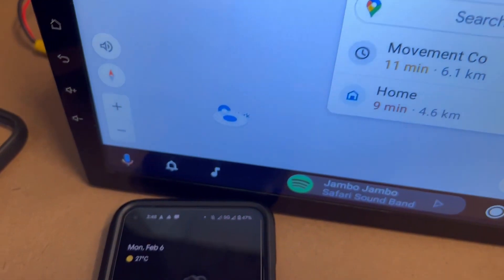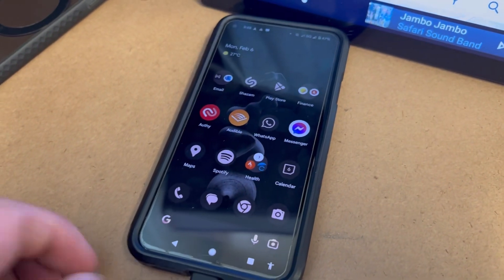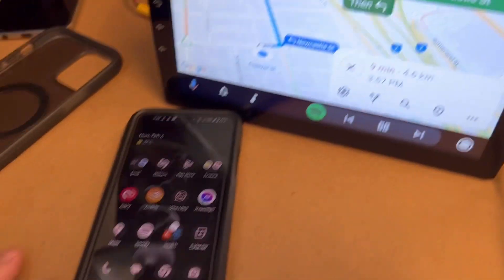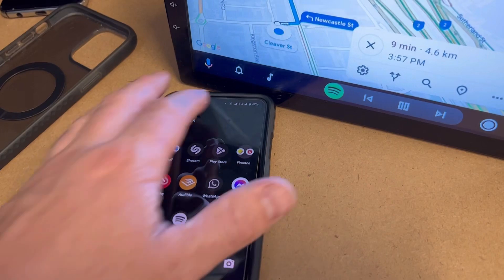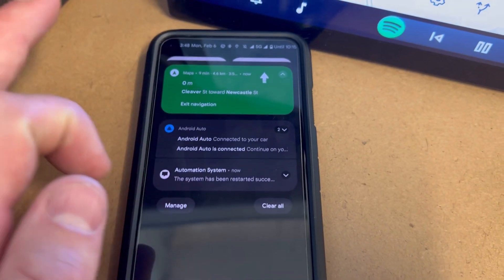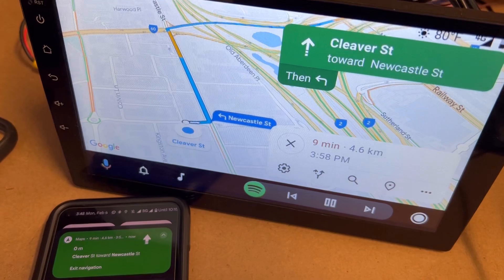There isn't any rhyme or reason for why this happens, but that's just what you can do to get it set up. Now I can pull this USB cable out and you can see we still have Android Auto — it's on wireless Android Auto, it just helped to have the cable in to get it started. Sometimes you don't have to put the cable in, just try restarting your phone and leave it for a minute or so. Also, sometimes when you plug in the USB you can go to Manage and change it to Android Auto, because it could be set for USB charging only. So those are just a few troubleshooting steps.